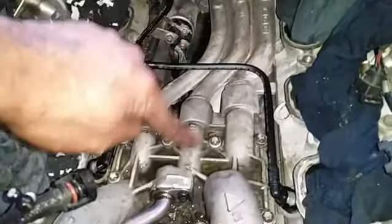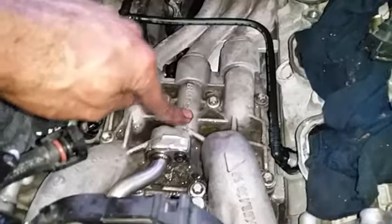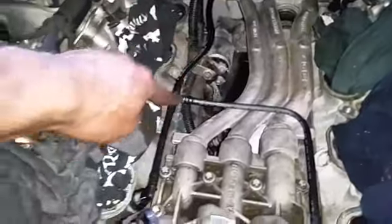It's all back together now. I've got a new thermostat on the other side of this thermostat housing, new o-ring, new gasket, new tee piece at the back there — that was a really painful one to do but managed to get it done. I've got a new white piece there to transfer coolant from bank 1 to bank 2.